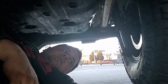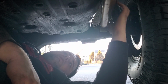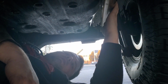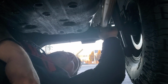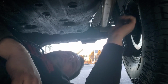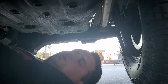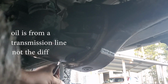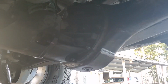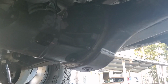As you can see, these guys here are my new lower links. It's a 2-inch 250 wall, and then 2 5/8 width high, and these are Barnes and Duro joints. Those 2 bottom ones on a 9-inch you have to do with a wrench.